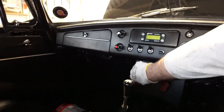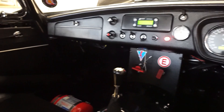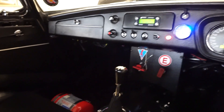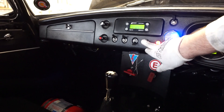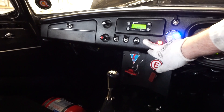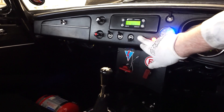To run the test we have the ignition on, car out of gear. For this one I'm not going to put the throttle down, just to see if there's a difference on the reading. So just press the starter - I let it turn over ten times. You could probably do it a little bit less than this but I find ten gives you an accurate reading.